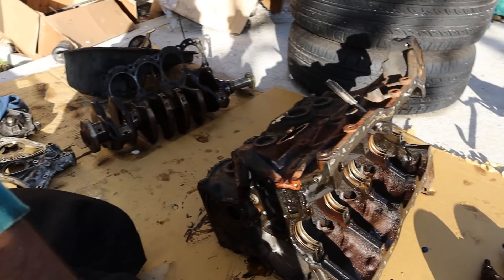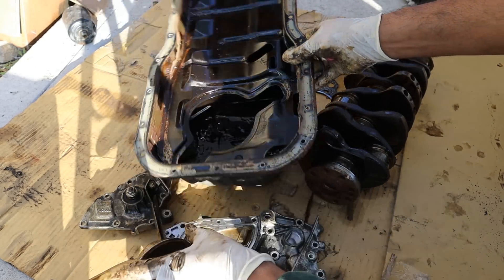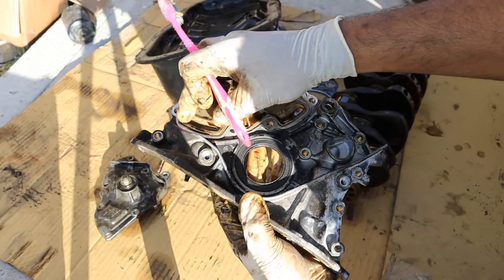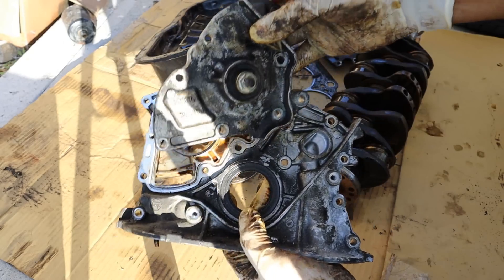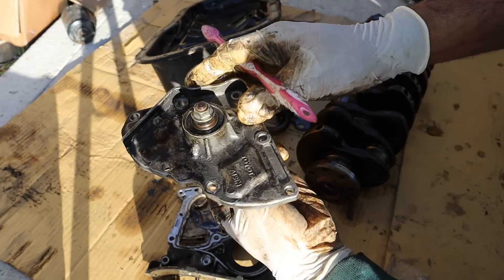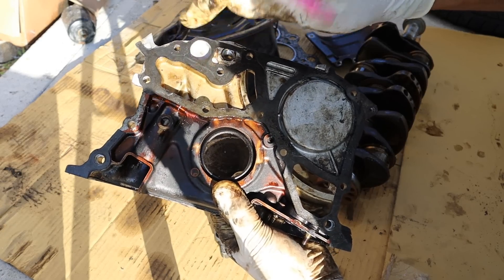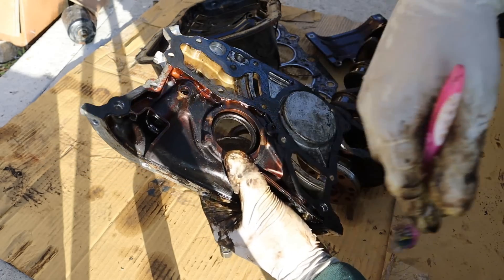Here we've got the entire engine laid out to take a look at how it works. Starting at the bottom, we have the steel oil pan with a baffle that tries to keep oil near the bottom where it can get sucked up by the suction tube. The oil pickup tube brings oil directly to the oil pump assembly. The oil pump has an inlet over here where it draws oil in, generates oil flow, and pushes it out through this port. This engine is from an era when oil pumps were actually serviceable items — you can replace this oil pump because it has a bearing and seal that can wear out, as opposed to newer engines where they are internally chain-driven or crankshaft-driven and not serviceable. There is also a pressure release valve in case things get too pressurized, which vents back to the sump.